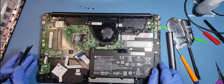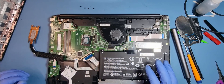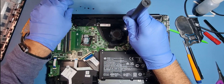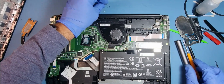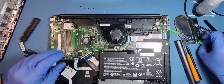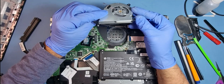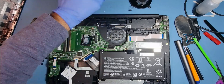To be fair it doesn't look great — it looks a bit dry. We're going to remove it now, clean it all up nicely, and put new paste on. I want to remove the fan as well and clean it out inside with an air duster. A good way is to check there's nothing in the way. Okay, just remove the connector for the fan.